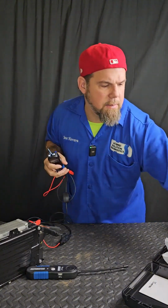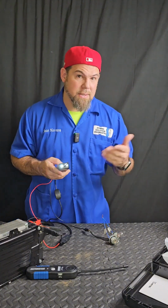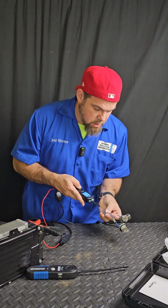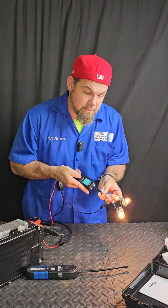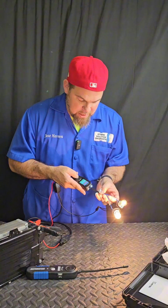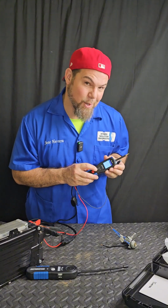Now, how do I use these leads? Well, first thing I'm gonna use is, for example, this pair of bulbs. I could probably connect the ground right here. Let's say if you want to test the load, you want to test a relay, you want to test a fan, whatever, you can just connect your line and inject power. Look. You can perform a load test very nice with this. Well, if you have another source of energy, you can also inject ground.